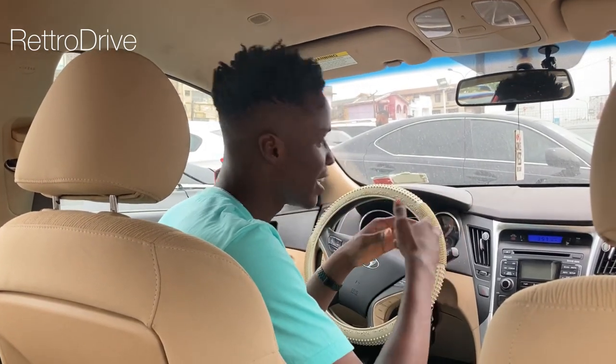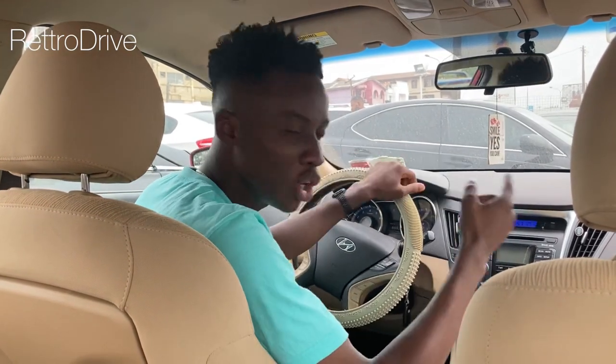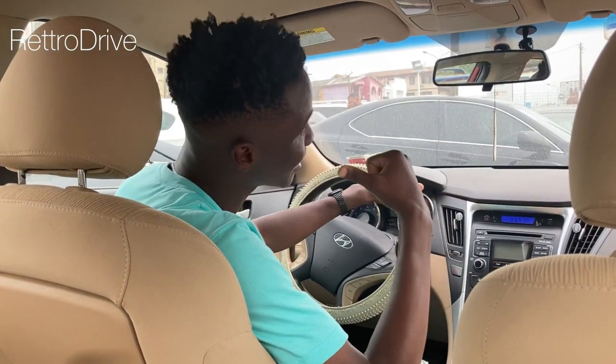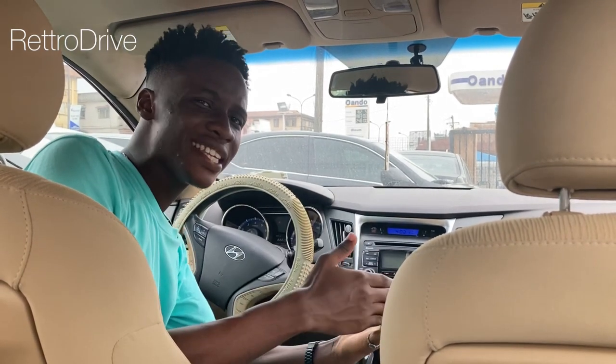The evaporator in a car is where the liquid refrigerant turns into a gas, and then a fan blows hot air through it and removes the heat. Contrary to popular belief, the AC vents do not blow cold air into the car — instead, they take out the heat from the warm air in your car, making the temperature drop so you feel cold. The gas then moves back through the system where it is brought back to a liquid phase in the condenser. For it to condense easily, it needs to be compressed by the compressor.